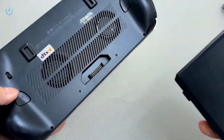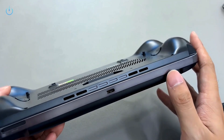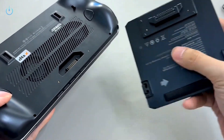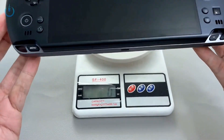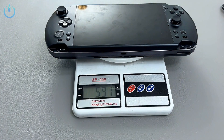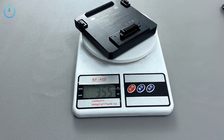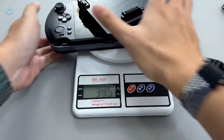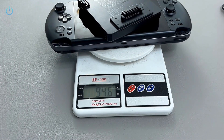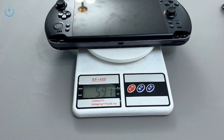Finally, we must discuss its optional accessory. The handheld device itself does not come with a battery. This year, in order to fit the AMD Strix Halo platform into a handheld, they had to eliminate the sliding keyboard and even the battery to make it feasible. However, they thoughtfully included an 80 watt-hour external battery. The device itself weighs 591 grams, the battery weighs 355 grams, totaling 946 grams — unequivocally the heaviest 7-inch handheld without exception. Playing with it plugged in is clearly the typical usage scenario, in which case the 590-gram weight is relatively light for a 7-inch handheld.